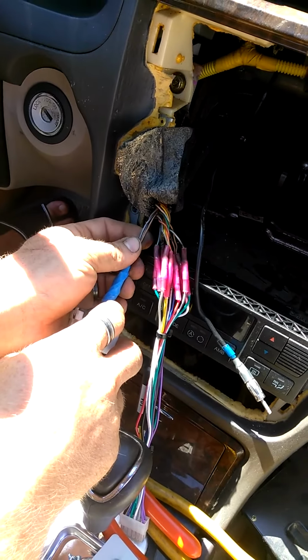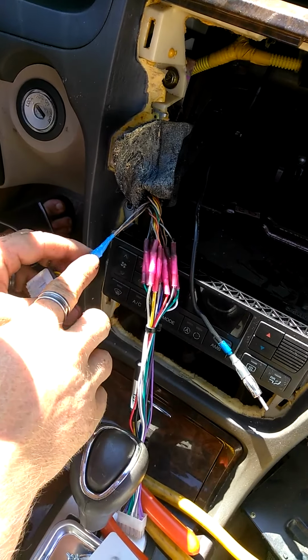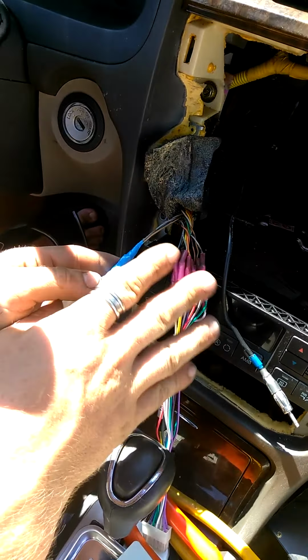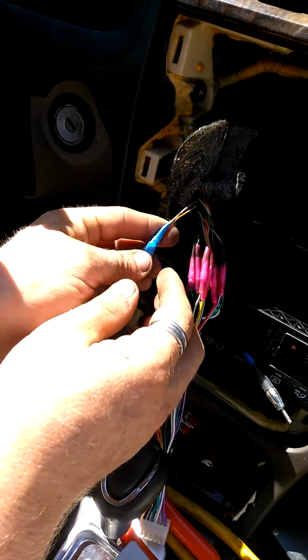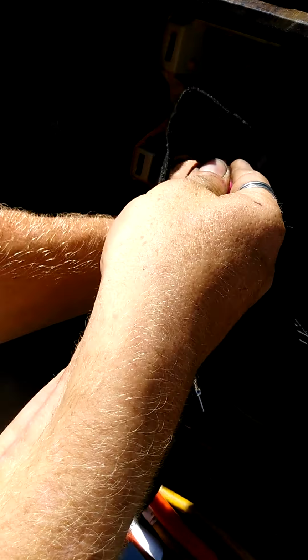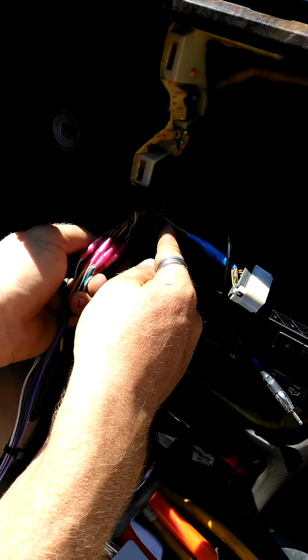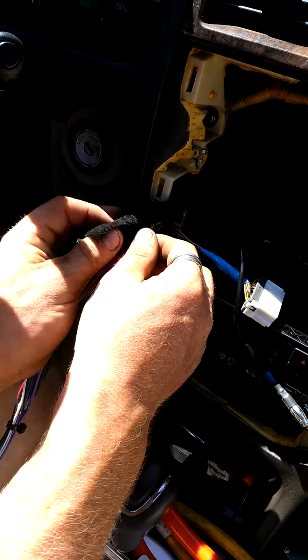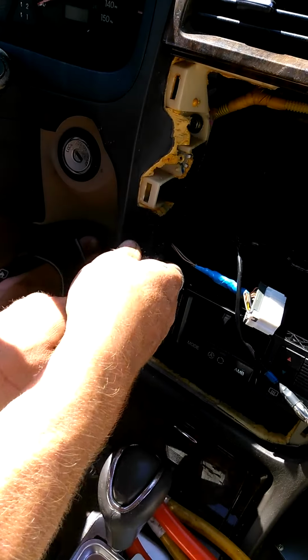That is for the LED backlight on the old head unit and the dimmer positive and negative. I taped them up so that there's no connection to any grounding. And I'm going to pull this away from the harness itself. I'm going to leave this out, and I will go with vinyl tape all the way up to the original harness. I will take the nice factory felt.